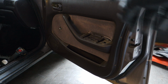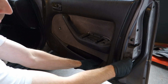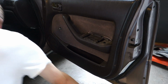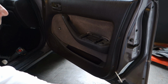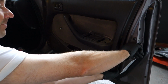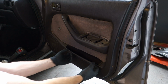Okay, and next, when I have taken those screws away, I can take this panel out. I insert my hand in first in here, and in that area I pull that out a little bit, and then I insert, please use gloves, my fingers in here between the panel. Or actually I can also use this screwdriver, and I insert it carefully in here, then bend it a little bit in that position, and then I insert my fingers and pull out this panel. First one hand is in here, then pull out, and now we hear this click, first in this down area, only that area, not in here, only this down area, like here, in that way.